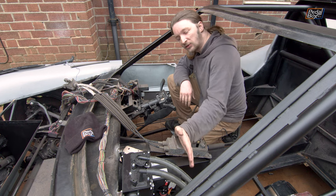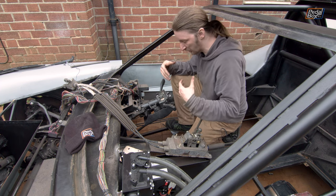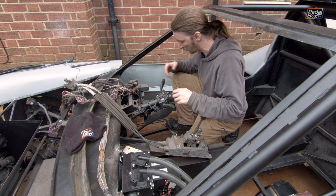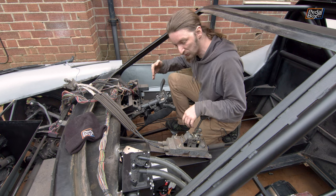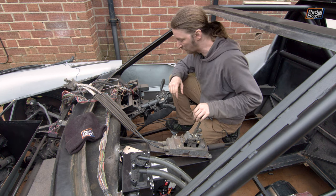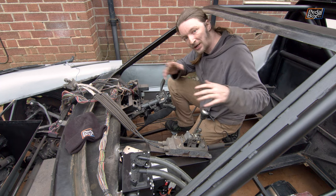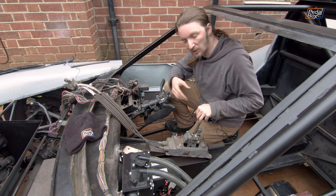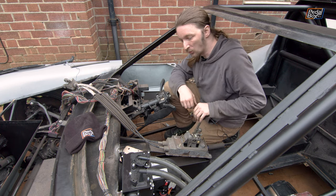If you follow a line from the top of the heater box out to the relay box, we've got a bit of a problem — the relay box is about as far out of the car as the dashboard can be, since we still need room behind there to reach the key switch and other controls. That imaginary line doesn't actually clear the heater box, so we're probably going to do a kind of asymmetric or staggered dash: on the driver's side it'll be nice and neat, tucked close to the bulkhead, whereas on the passenger side we'll bring the dash out quite a lot further — use it as a shelf, maybe some improvised storage — now that the heater is in and we know what shape it can take.